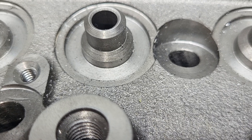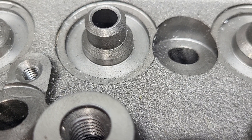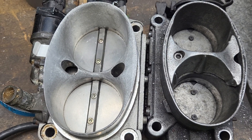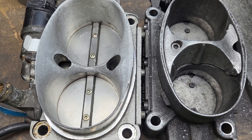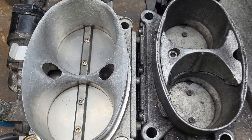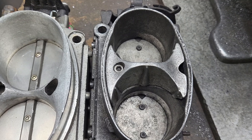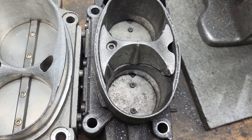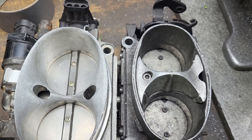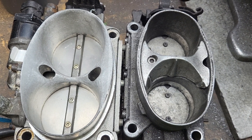I've done all the flow sheets with the intake manifold and the head - all of that is all done. The owner actually asked me to try it with a stock throttle body. The one on the left is my BBK - I think it's a 52mm - it flows really well and it's had some work done so it's probably a touch better than stock. On the right is a bone-stocker with an added piece that I left in - I figured it couldn't hurt. This one has had absolutely no work done to it at all, and it's certainly interesting to see the difference on the flow bench. I just did it with the last one tested, which was number two in the firing order.